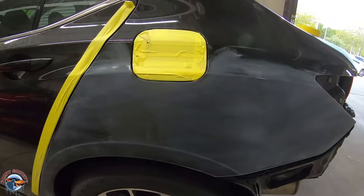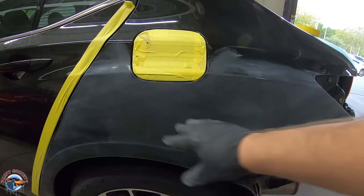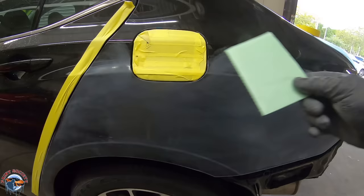You can see how we use our 800 grit - now we'll come back and finish up some areas that are just a little bit shiny. This is where it helps to have a very good tool. It's all in the prep, or else when we go to blend in that line it's not going to work well at all.